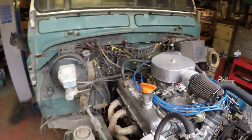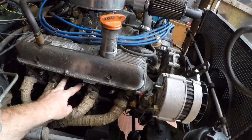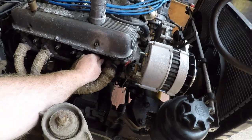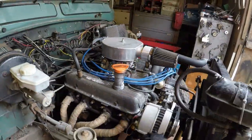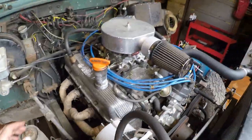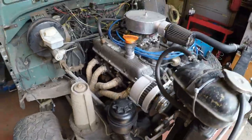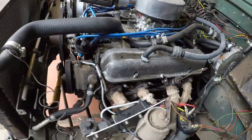The compression test is all done. We had one low cylinder down to 50 psi; the rest were around 130. One cylinder was a bit higher and the adjacent one a bit lower, which makes sense — the low one allows the neighbouring cylinder to move faster and generate a bit more compression. Overall the engine's in pretty good condition, but we've got an issue: the customer informed me this engine swallowed a bolt. We suspect it's gone through the cylinder and done some damage, so we'll be stripping it down, checking everything over, and fixing the problem.